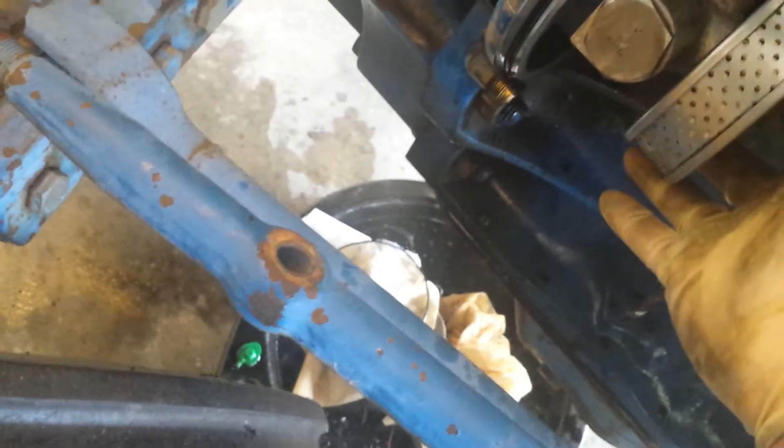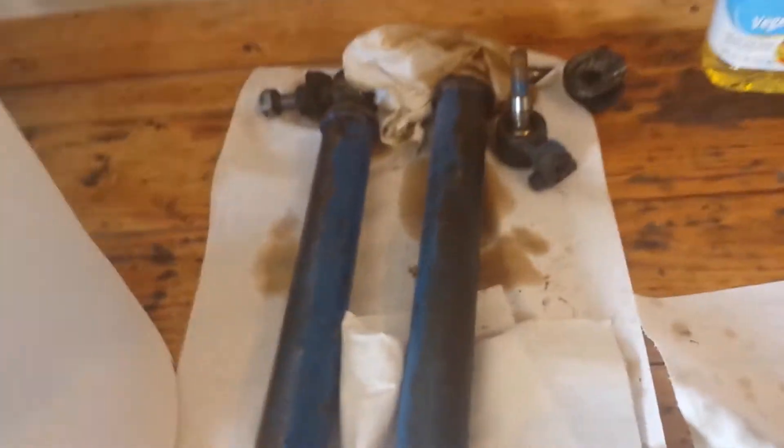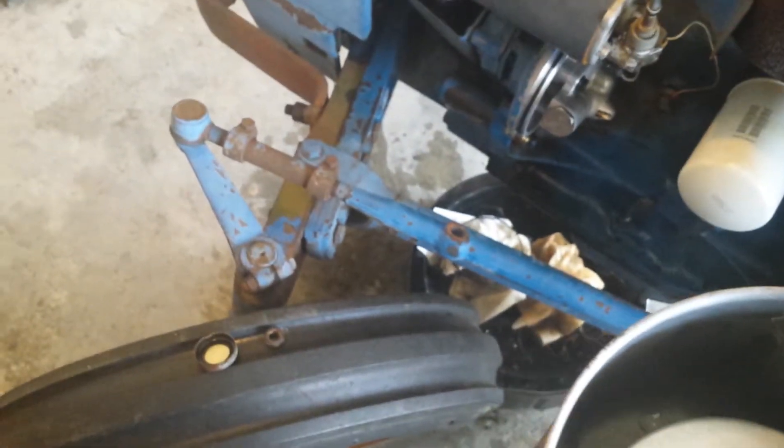I'm not sure how hard this is going to be — that's not going to stay on there. So I'm going to have to put this in the housing and stick the bolt in the back to get the filter to stay in and not fall completely out. If you can juggle it, put that on there and make sure it's square. You can always catch your finger in the fill hole and move the filter around, but you've got to make sure it stays in there nice and square. That rib right there is going to help it seat real good. There's not going to be a rubber seal anymore, at least not on this filter — the rise in that filter is going to seal the surface, so it's going to be a metal-to-metal sealing surface.